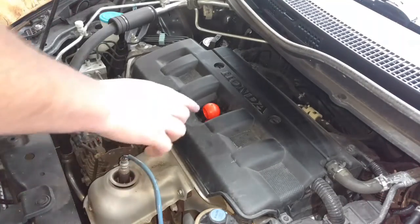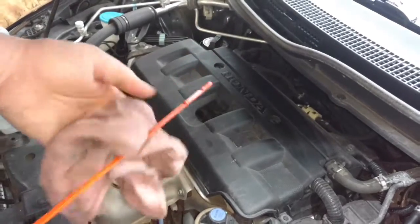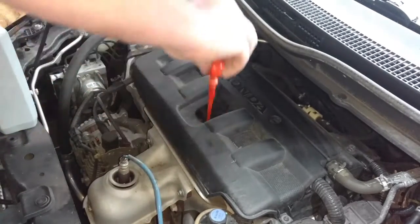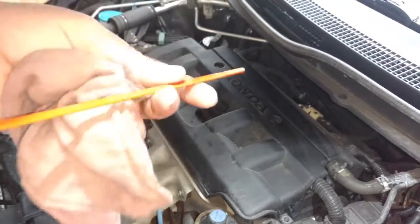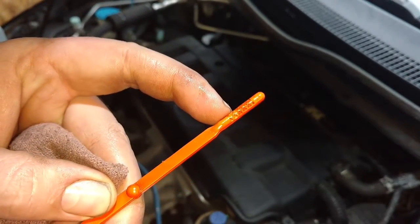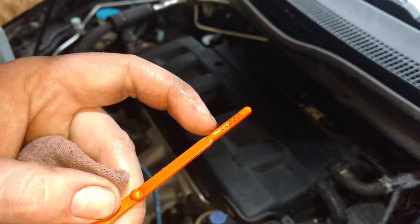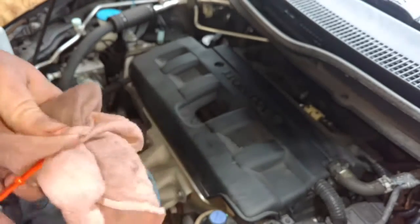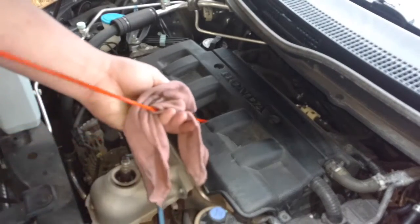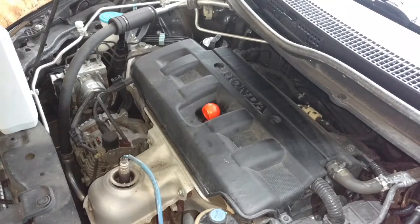We have removed the car from the ramps and ran it for about 60 seconds. Don't want to run it too long in case the oil is low. Wipe the dipstick, pull it back out, and check the level. This looks about right — as long as it's within the safe range you're normally good. I like to put it closer to the top, so about 4.5 quarts will do — it doesn't take the full five. I'm going to go ahead and top that off. That pretty much sums up how to change the oil in your 2012 Honda Civic. This has been Repairs and Reviews — thanks for watching.